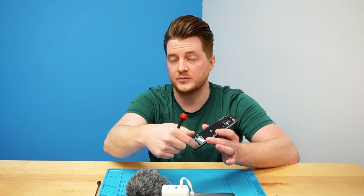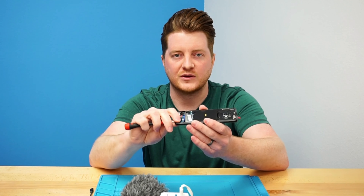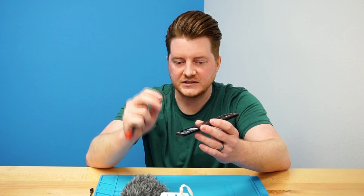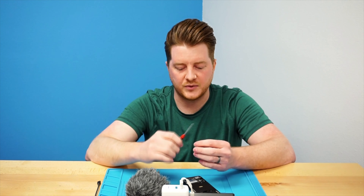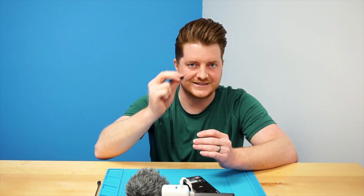In this particular instance, the way that I do it to prevent any kind of pry damage from happening is take your tool, insert it as if it's like a headphone, and then pry backwards. This will lift out the headphone jack completely safe and prevent any kind of pry damage that you could cause to the inside of the device. Inside the headphone jack, there are no contacts along that top ridge, so you're not going to damage any of them as you pry up, and it's really not a lot of force that you have to apply when you plug it into the jack like that.